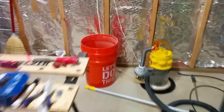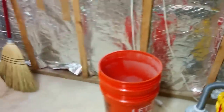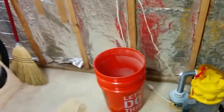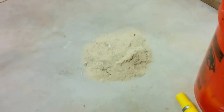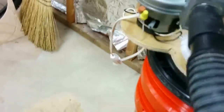That's about as much as I got until it imploded on me. So using two five-gallon buckets, I used one inside the other, roughed them with some sandpaper, and then used some heavy-duty Loctite in between the two. The two together create enough reinforcement that this thing will not implode. I've got a pile of sawdust here — you just sit that right on top and you really don't have to worry about clipping it down because the vacuum is going to do it for you.